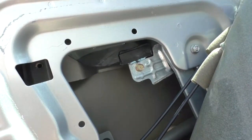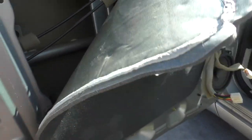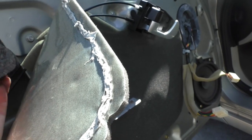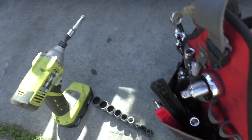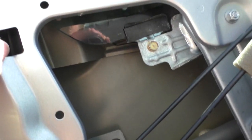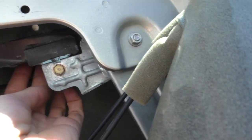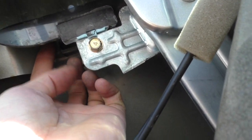Now I'm going to attempt to remove the handle. First thing I did was just peel this back — it has this reusable glue stuff on it, so don't be shy when you're pulling it back. Then there's this piece here but you just have to pop these plastic clips out. Be careful — I kind of broke it, and be careful you don't drop the clips down in the door. There's a little bolt right in this hole back there — it's going to be a 10 millimeter. There's another one right here.